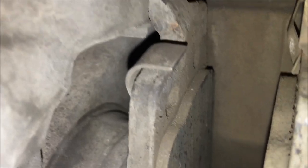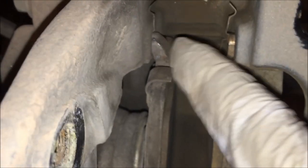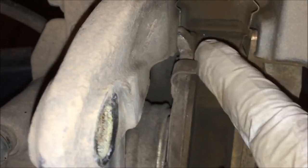This is why your brakes are squeaking — you can see that the clip here, when the brake pad wears down beyond the clip, the clip rubs against the brake rotor and makes a noise. That's the wear indicator warning you that something's wrong. In this case, these pads are worn down too much.